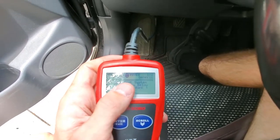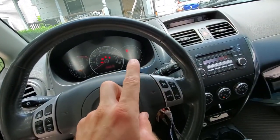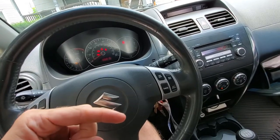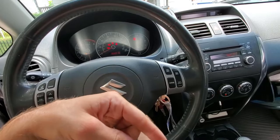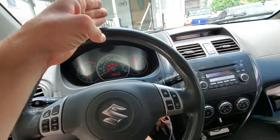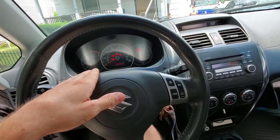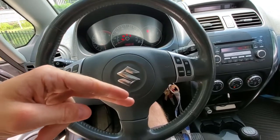When I first got this code, I figured I had an O2 sensor problem. I have one on the front end of the motor — the upstream — and one downstream, near behind the cat. I replaced the first one because it was the cheapest one I could find. I put it in and it rode without the light for about 30-40 miles, then it popped back on. So now I know it's the downstream O2 sensor.